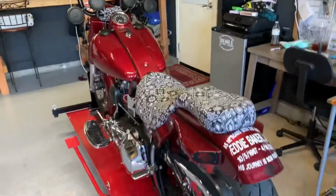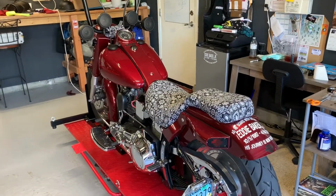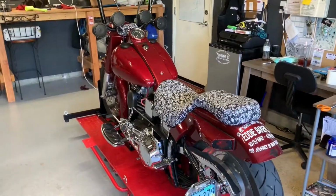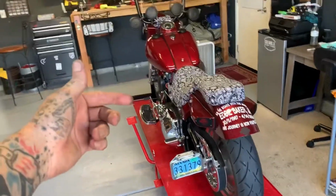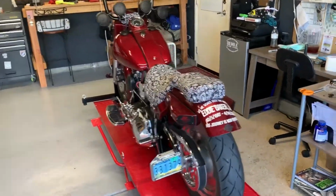I definitely rebuilt the solenoid the way it was supposed to be. Now we just wait and see if that wind ever happens again. And if it ever does happen again, I'll definitely let you guys know. But for now, it seems like that did the job, because it struggled firing up. And normally when it would struggle and I'd go to start again, it would wind on me. So, it seems like I did it.